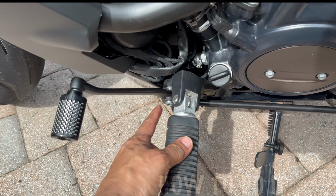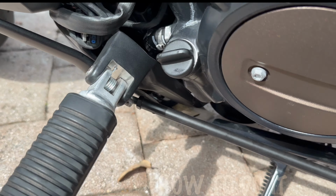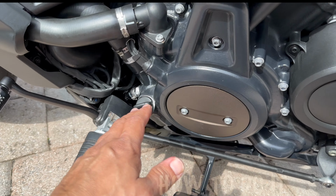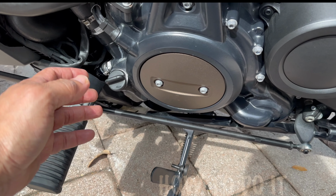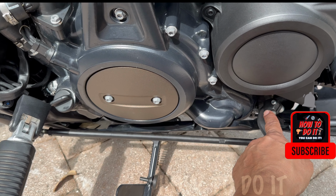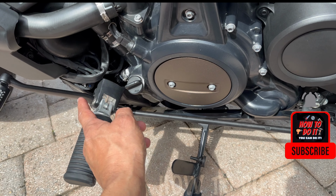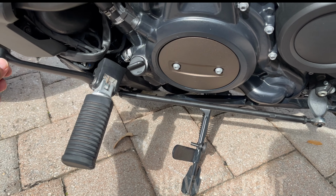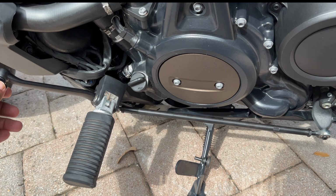What can happen is if you have a lot of resistance right there and here and over here, that adds to the shifting of the gear, so it just makes it harder because all that friction is eventually making it over here. Of course you do have friction over here when you're changing the gears, but all these add up to the additional friction that you already have on the transmission. So by lubricating that, at least you're taking that out of the equation. So highly recommend doing that.